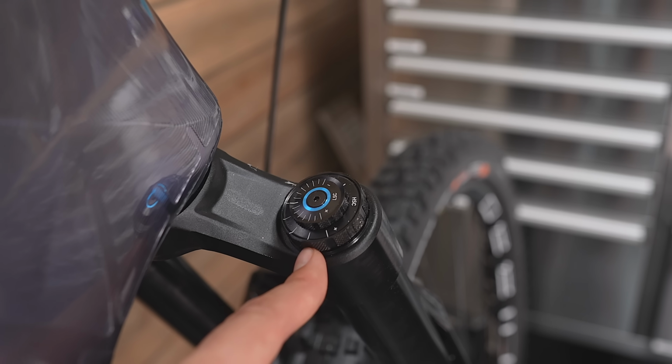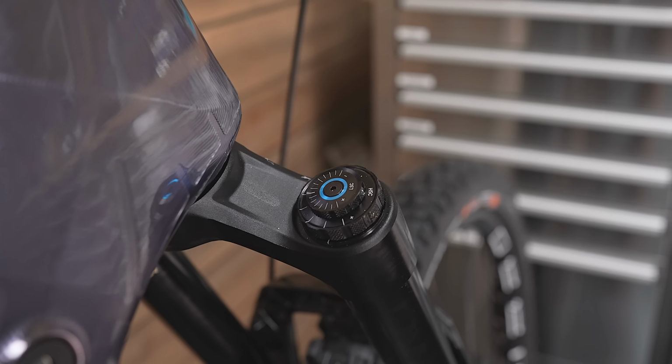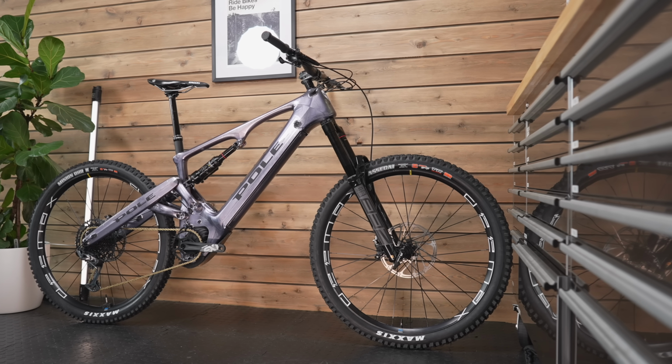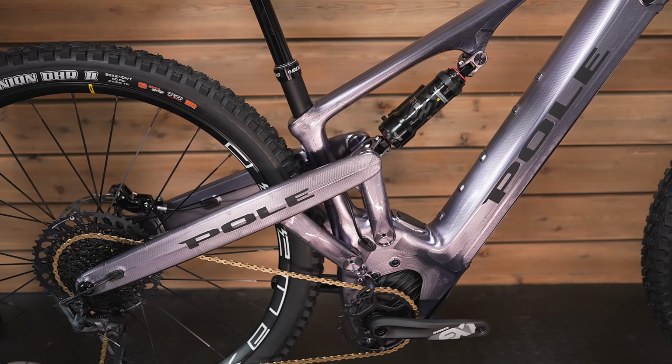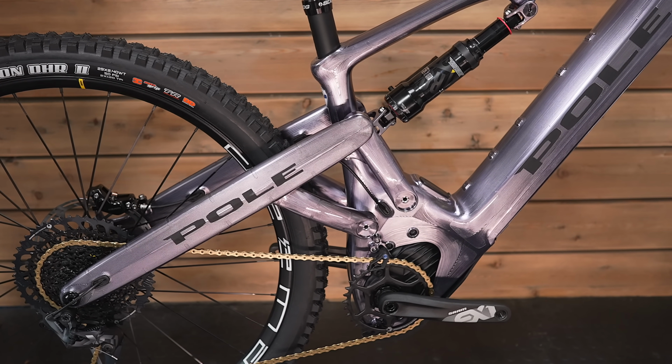2023 Charger 3 in here as well. So interesting to see how that runs on a 190mm fork. So 29er wheels front and rear with 190mm of travel at the rear as well as the front is an incredible feat of engineering, because when you start to introduce long travel and big wheels, you've got to make enough clearance on all frame sizes for that rear wheel not to come into contact with the seat tube, and enough space for all the linkage to compress.